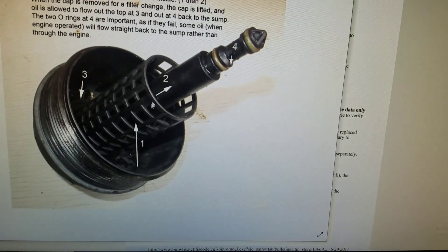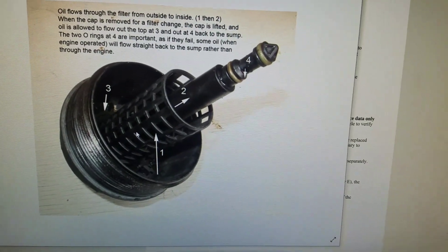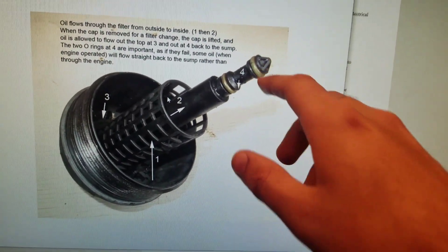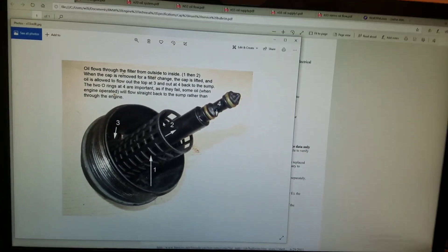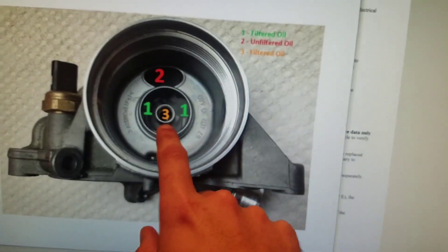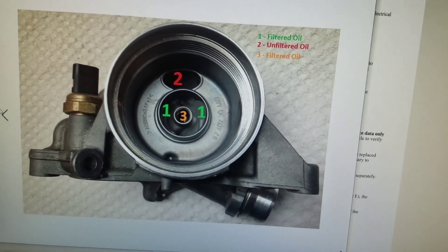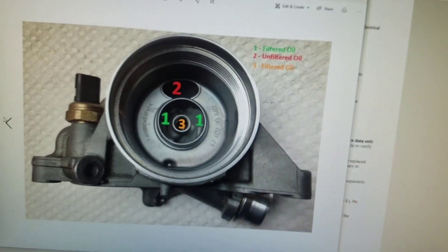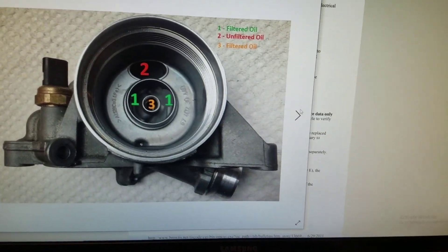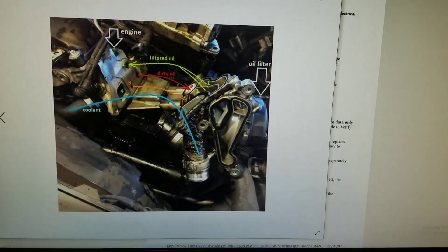What this insert does is: one, hold the oil filter and prevent it from collapsing, and two, seal up the drain back into the crankcase. When you change the oil on your M52, M54, M62, or whatever engine you might have, you take off the oil filter cap and this insert — which is normally sealing up a hole — comes off with it. That hole is always empty when you go to change oil, because it drains back into the oil pan. Normally when the cap is in with the insert, that hole is sealed up so no oil drains back.